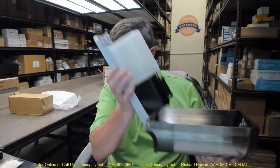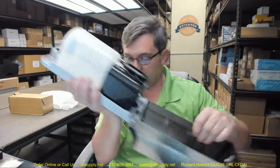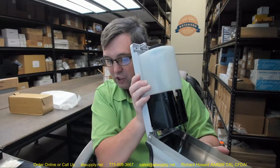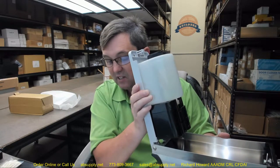Should the dispenser be out of order and batteries have been replaced, do not attempt any repair work — call a dealer. For battery low indication: with the housing cover open and soap reservoir removed, perform the following diagnostic test. Press and push up the cover safety interlock switch — the blue stem on the bottom — and hold it. Observe that the LED is lit blue and flashes four times, indicating proper function at standby level. If the LED continues to flash blue, that's the indication to replace the batteries. Four flashes is good; continuous flashing means replace the batteries.